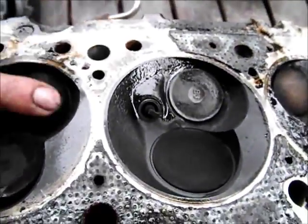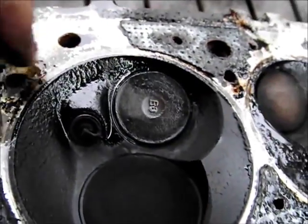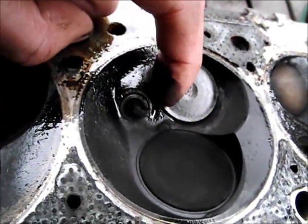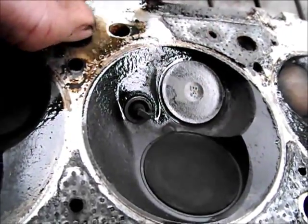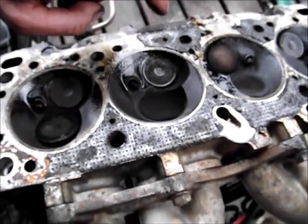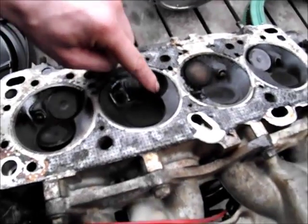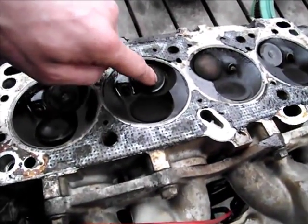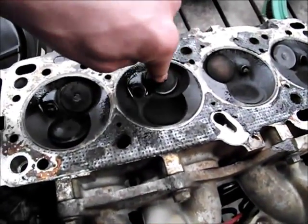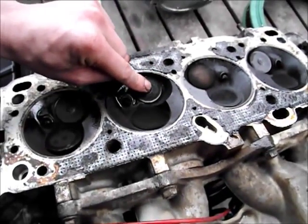You can see when I shine it up with some oil — it's flat, right? But go to this number 2 cylinder and it's nowhere near flat. It's kind of started to curl over. That's why that valve's clearance was really tight — because as the valve heated up and got hotter and hotter, its ability to seal was compromised greatly. When this cylinder was firing, this valve was partially open, not fully closed.